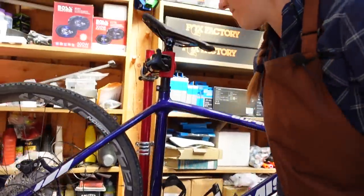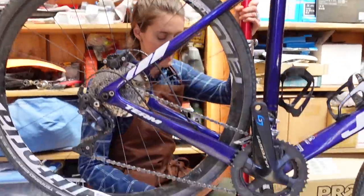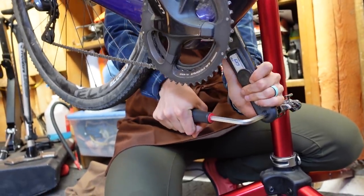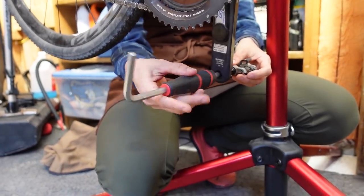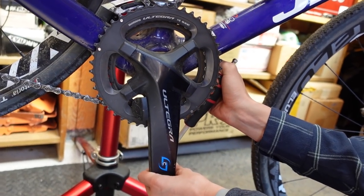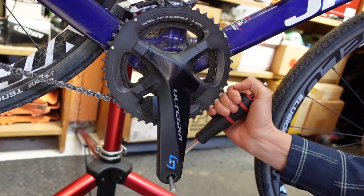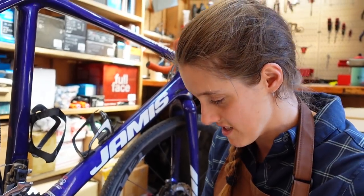At which point they're really stuck or you strip the crank, and that's no good. The non-drive side is reverse threaded — that just confuses the living daylights out of people. So crank arm is straight down, Allen key is towards the back of the bike, and you just push straight down. You do not want to do what we've seen people do on the internet — if you have it like this and you're pushing up, you either punch the frame or the chainring, and it's not good. I've seen people cut themselves so badly on this. Anyway, that's our sermon today on pedals.